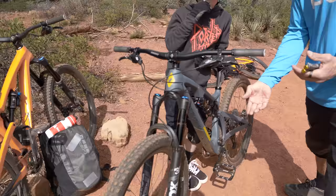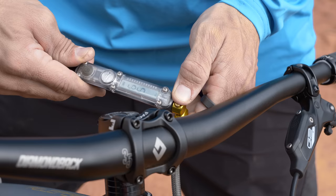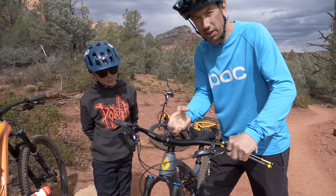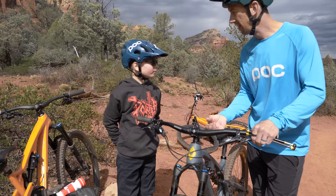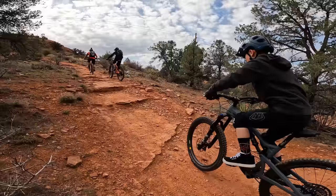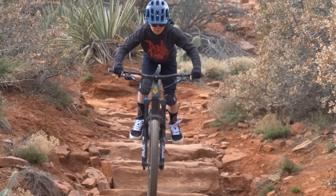We're out on trail now, we've had some riding in and we're seeing how the suspension is performing. I've already set the rebound all the way to the lightest setting. A good way to tell if rebound damping is too fast is if you're bouncing off stuff and skipping around. If it's packing up and you feel like you're down too far in your travel, your rebound damping is too slow. Another way to help Owen's bike ride better is to lower his tire pressure. With these Kenda 2.4 inch tires, we can run about 15 PSI since he's so light. This will effectively add usable suspension and really improve traction for climbing, cornering, and downhilling.